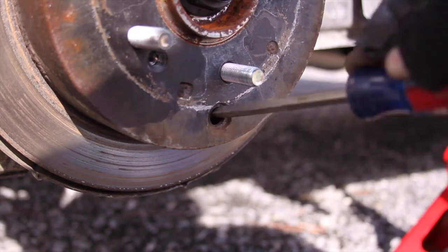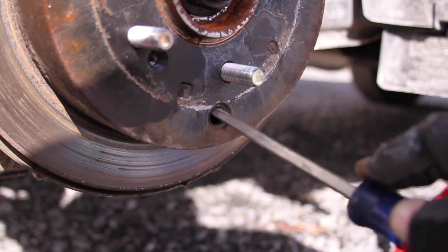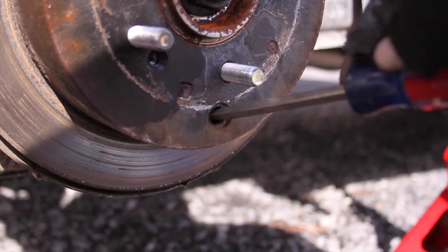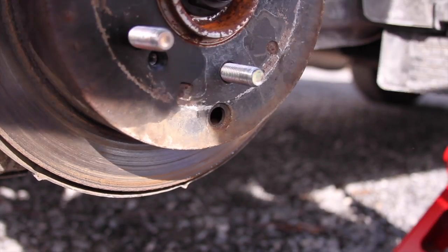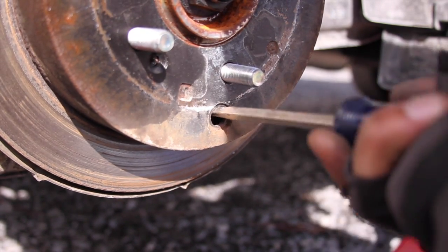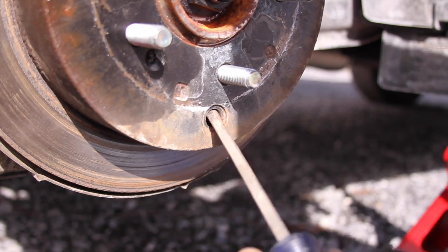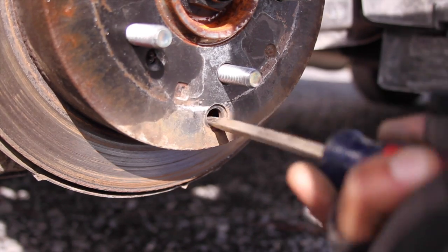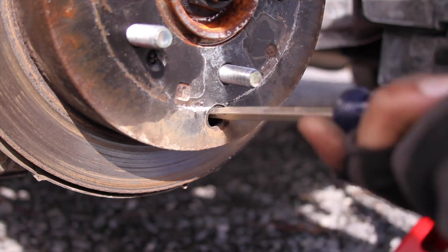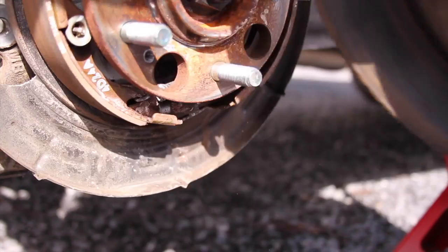And it might be tough to actually turn it, because there's a spring that almost sits in the teeth. Alright, let's see. I can never tell. Alright, so there. I guess it is down. Yeah, it's definitely in the downward motion on the gear of the adjuster. And I'm going to readjust the emergency brake when I put it back on. Alright, so there we go. It's off.